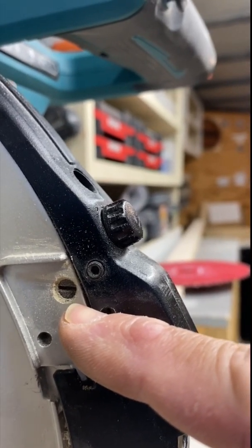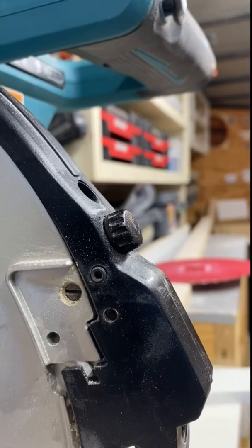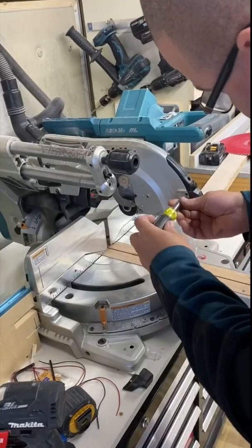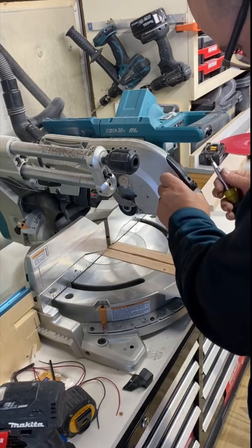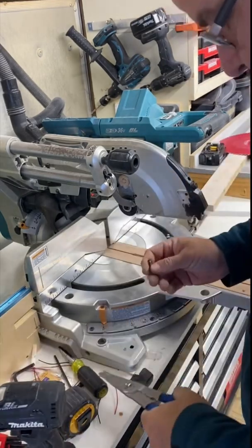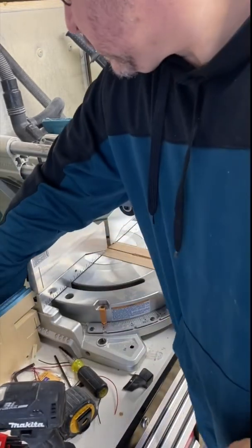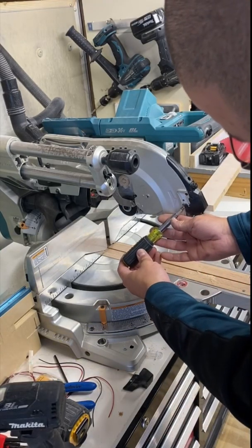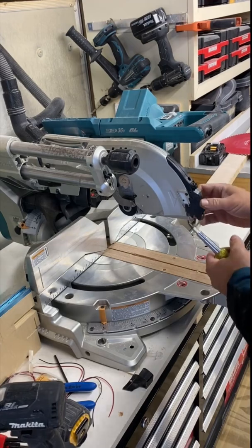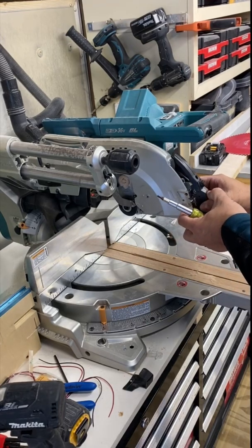You're gonna take a little flat head screwdriver and take out that little flat head screw right there. It's a long tube that's threaded just a tiny bit on the other end and it goes all the way through. Then you're gonna use your flat head screwdriver to pry this piece of plastic up on both sides — it looks exactly the same and then it pops off.